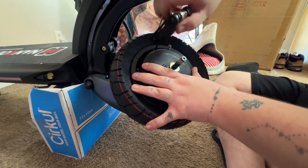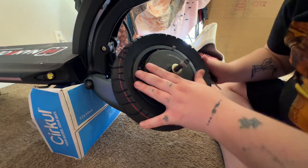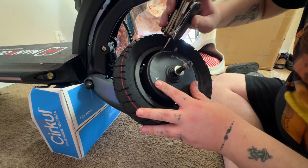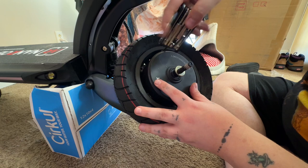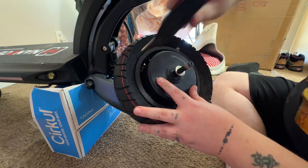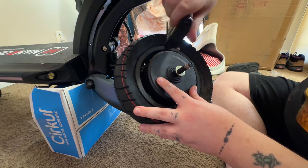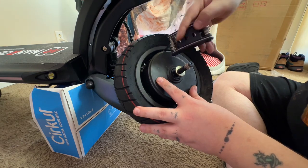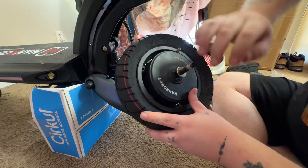And keep in mind, with these screws, you don't really want to tighten them all up at the same time. Go a little bit on one, and go to another one, etc., until you get them all tight. You know, kind of cross. It's like pop, pop, pop, pop type deal. So once I got that guy in, not even firm, just a tad bit snug, like I just felt a little tiny resistance, I'm going to go in, put another one in.